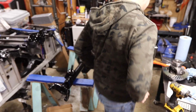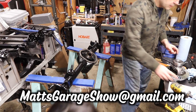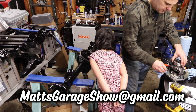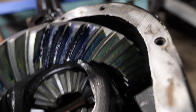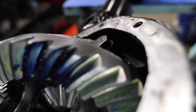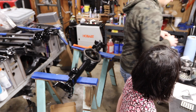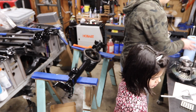The pattern is broad, which is nice, but it's too far on the outside of the ring gear. The coast side looks good. So what I'm doing is trying to get these gears to mesh up perfectly — that pinion gear in the center. The pattern is at the bottom of the tooth on one side and high on the other. This is a 5 thousandth shim — I'm going to clean the old paint off and swap it.